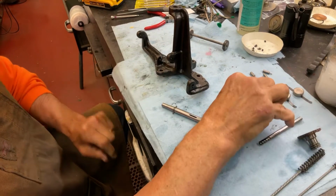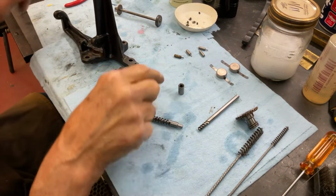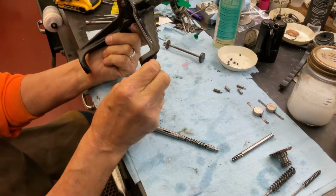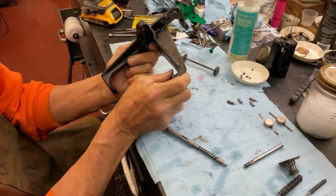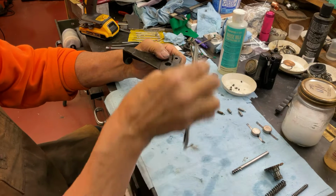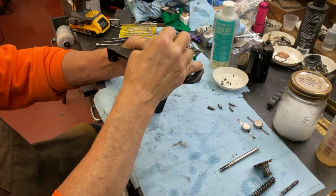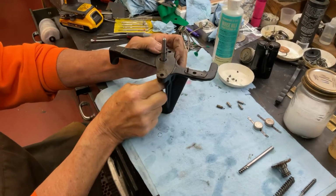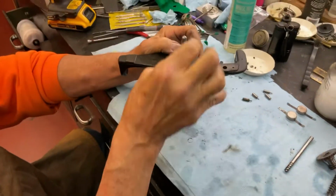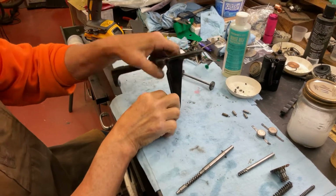So I'm going to talk through this. This is the end bearing to the spindle shaft here, which goes here. Wait a minute, which goes where? Here. The casting looks like this. We're going to stick the bottom piece in here, and that slides in smoothly for adjustment. So I have this working. I'm going to come in here with the spindle shaft, and I'm going to come down. And I feel a little resistance in this. This should spin smoothly, but I'll flex hone inside the spindle shaft so I don't have these wear marks anymore.